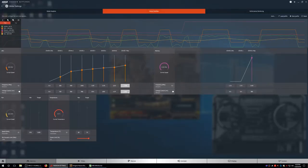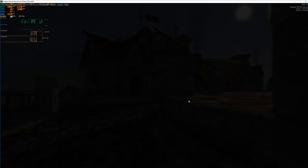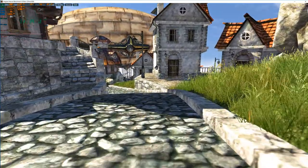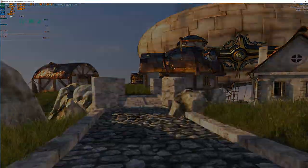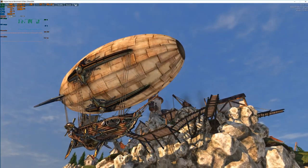If I want to save a little more, I can underclock to 1244 MHz. I already know it's going to go to about 90 watts. At 1244 MHz our FPS did go down like 5 frames, but I'm saving another 10-20 watts. It's jumping up a little because of those other states that I need to change. It only lost about 5 frames. I'd rather save the extra wattage — unless you really need those 5 frames, like if you're only getting 30-40 FPS in a game.